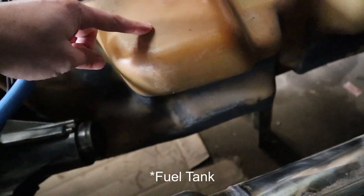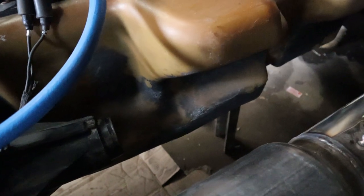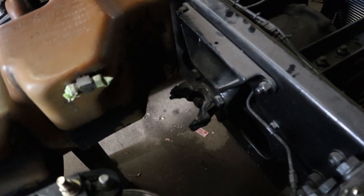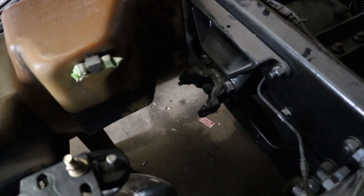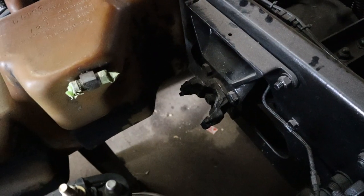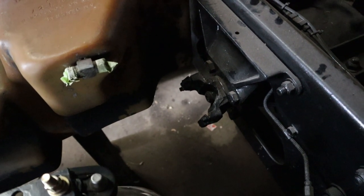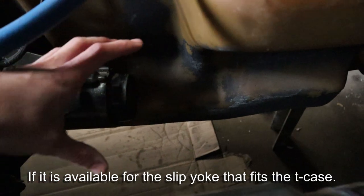There is not a whole lot of room between where this driveshaft is going to go and where the gas tank is - it is concave there where the driveshaft goes through, but a bigger driveshaft is going to have a little bit of issues with clearance. On the rear end here, I have 1330 series u-joints in the back. The front is completely different - it had all 1310 series u-joints. That's really what we need to know for the back portion, just for the u-joint going into our diff.